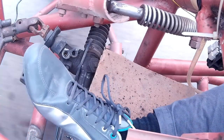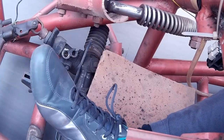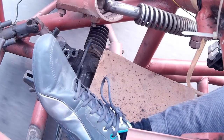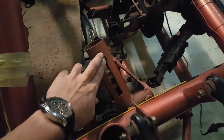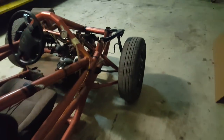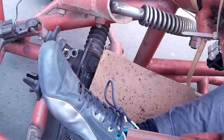Talking about suspension — this car had a push-rod suspension on all four wheels, and I was using shocks from a motorcycle. Since the car is so light, even motorcycle shocks were good enough. The suspension wasn't particularly well made — I made the rockers out of round tubing because that's what I had at the time — but the suspension worked really well. The great thing about a push-rod setup is it made things very easy to adjust: this long slot is where I could move the shock to different positions, adjusting stiffness. The rear suspension was also adjustable, giving me a lot of control over the car's balance — making the front stiffer or the rear softer.